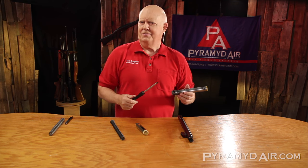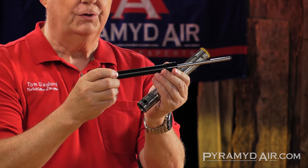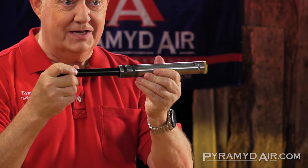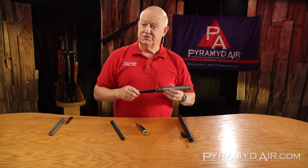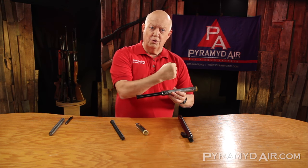If it's in a car in a certain place, they call it a gas strut, and that's where it got that name. I don't know where it got the name Ram — I don't care what you call it, as long as you understand that what it is, is a container filled with compressed gas that pushes on its own piston to extend this rod that sits inside this piston and pushes it forward.